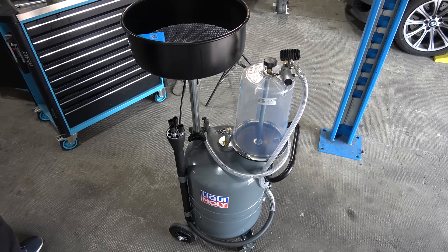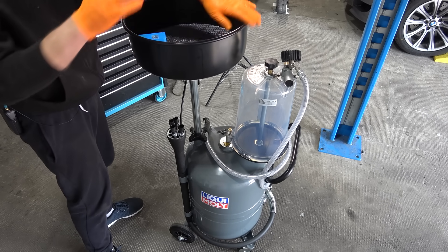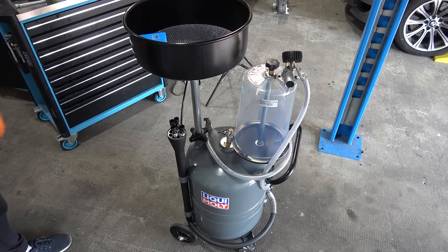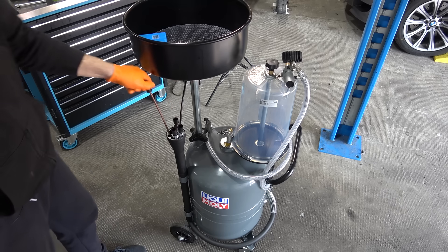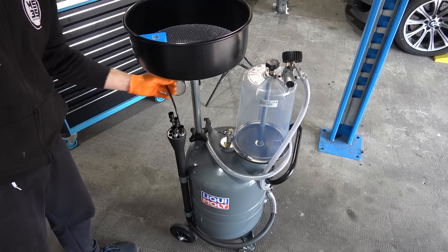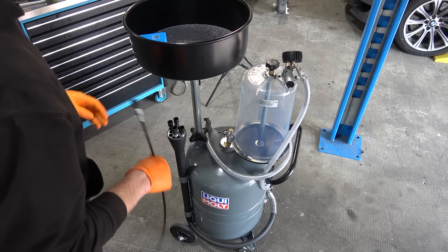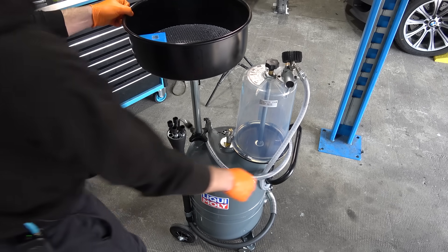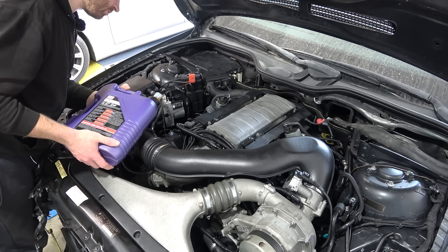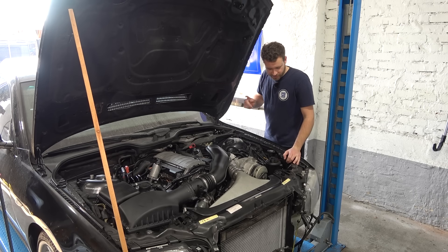We have cast iron sleeves and new piston rings, so until everything beds in properly we're going to see some sparkle in the oil — but nothing alarming. Running-in time will be around 1,000 kilometers of gentle driving below 4,000 RPM. Brand new filter — lube it up and clip in the new filter. Pre-lubing the filter by filling it with oil — you don't want a dry start. Using my Liqui-Moly oil extraction device, which is very convenient for quick oil changes. Fresh oil back in — all fluids checked. Let's get it going again.